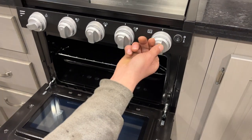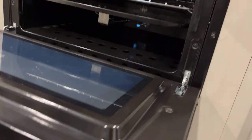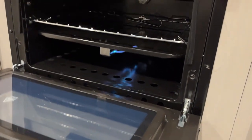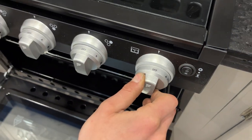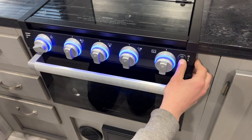For the oven, open it up, turn it over to the little pilot, and hit the sparker a couple of times. You'll see the flame in the back get going. Once lit, hold the knob for another few seconds and then release — the flame will hold itself. Turn up to your desired temperature and it fires right up. Once done, turn it back down to just the pilot. If you're going traveling, make sure it's fully off. The switch beside it — press up for the knobs, press down for the knobs and oven.